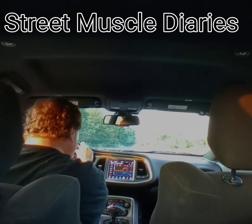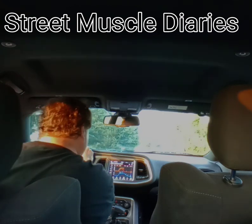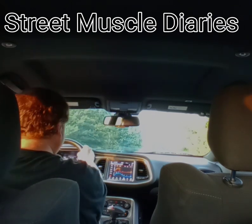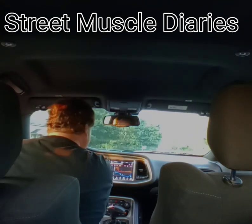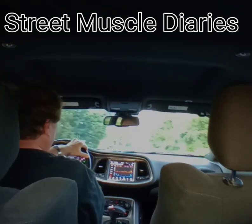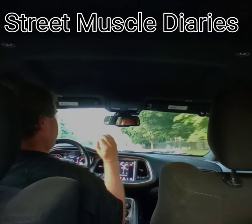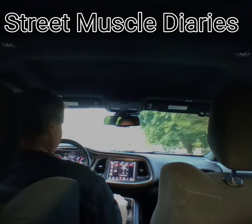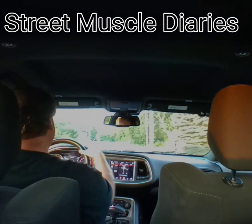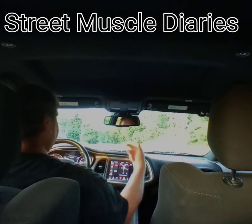And there we go. Look at that — 490 horsepower. And the torque curve line is about 440 pound-feet of torque on that pull. Almost touching 500, so that's like 490-ish. The torque is actually lower than what it's rated — if I kept going it would have climbed more. So that's about 440 pound-feet and 490 horsepower to the crank on that last pull.